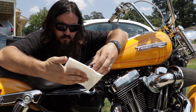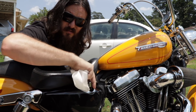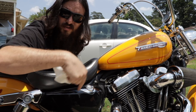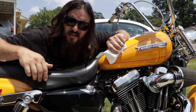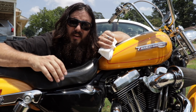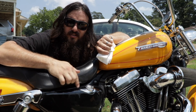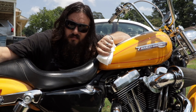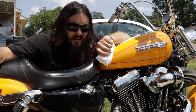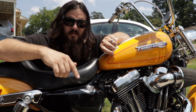For starters, I'll check the oil. It's important to note on this particular model — with an oil tank above the crankcase right down there — that some oil over time can drain into the crankcase. I'm going to double-check a hot oil check later. I can see there's oil in there, so I know it didn't all disappear and go somewhere crazy. We'll talk about it more in a minute.